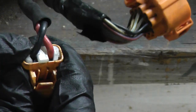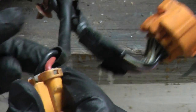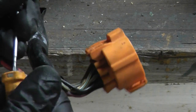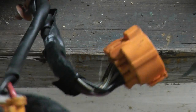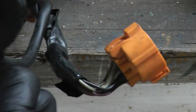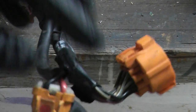First, look at the back of the connector. This one has a plastic retainer retained by two tabs, one here and one here. I'm going to get a small screwdriver and pry it out. Taking note of where it goes — the open end faces towards the clip.